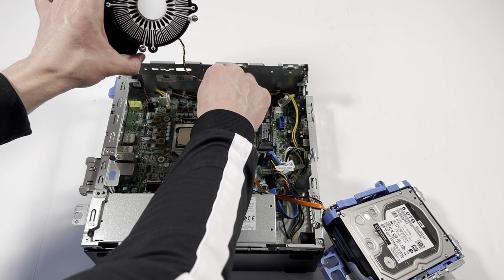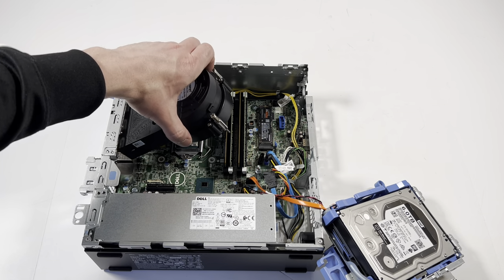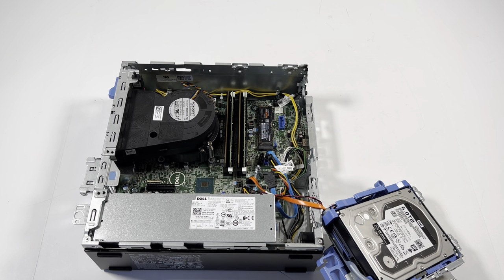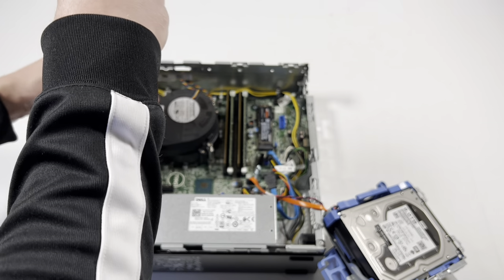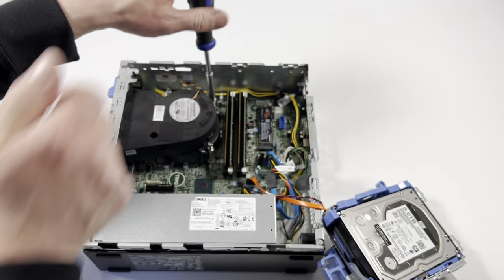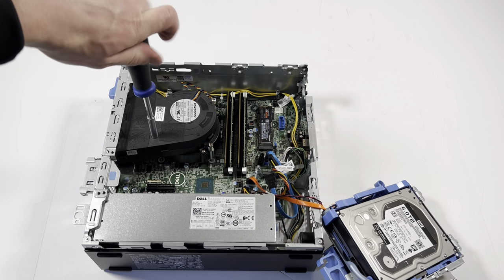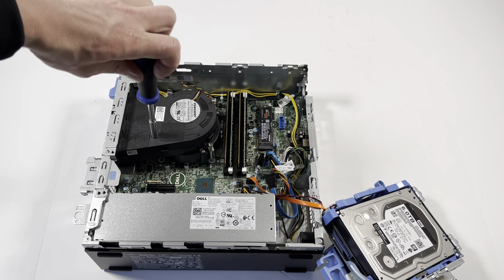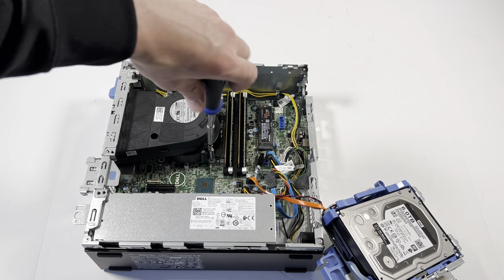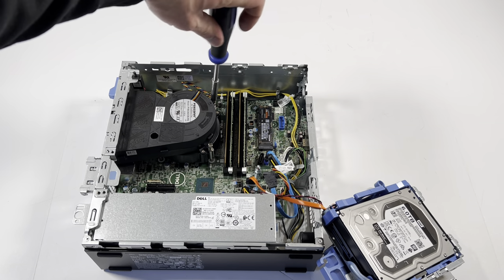Install back — connect the CPU four-pin back to the motherboard and install the heatsink. Take the screwdriver and go to each side to tighten the screws. I really like this small form-factor system — I use one right now in my office and I do recommend them. I'll put a link in the description so you guys can buy it online.